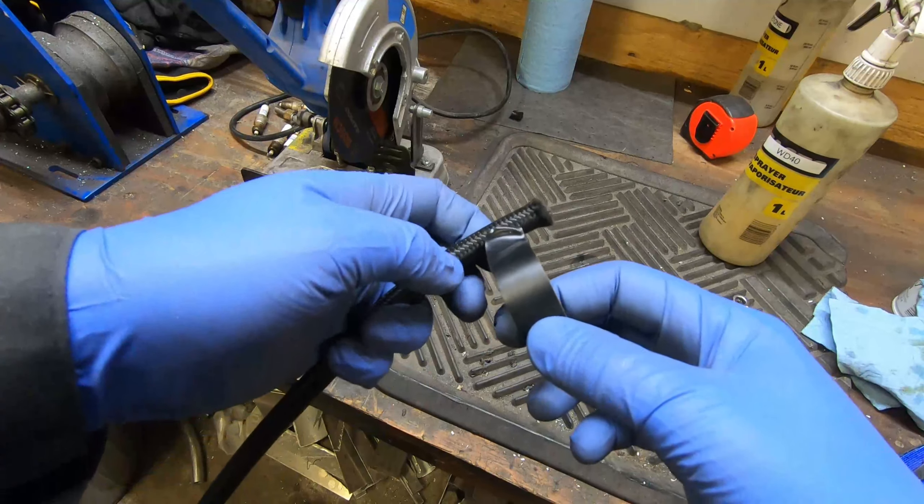I've encountered a problem, and it's from my own fault. The oil pan doesn't come out with the engine sitting as it is right now - the problem is this cross brace here. I thought I had enough room but I don't. The solutions would be to either lift up the engine, but I don't have the cherry picker in the shop right now. The other option would be to cut this and weld a flange on there so this bar would be replaceable, but that would be more work. So I think I'm going to just weld it in place. The pan is off the block right now - I'll lift the gasket so I don't wreck the seal, drill a hole, clean it up, and see if I can tack the bung on there.